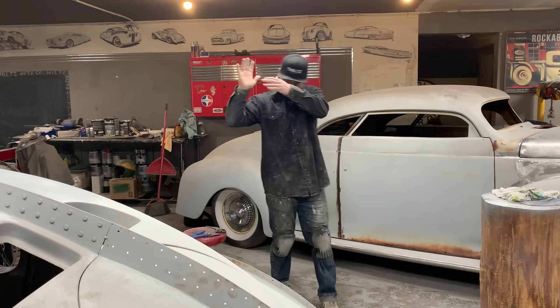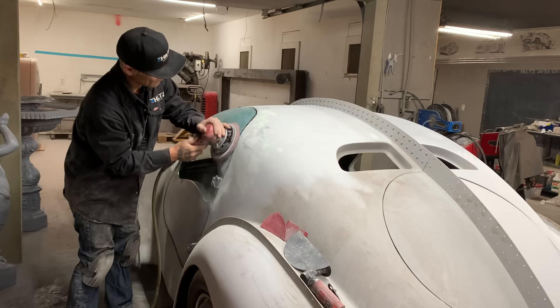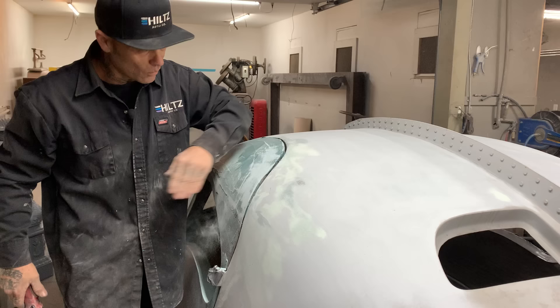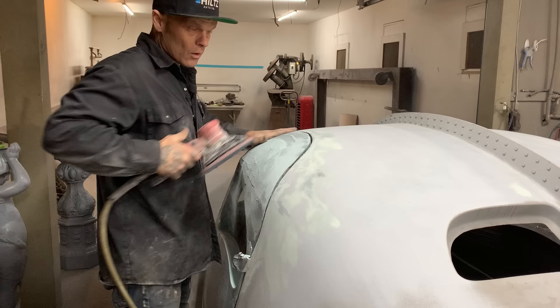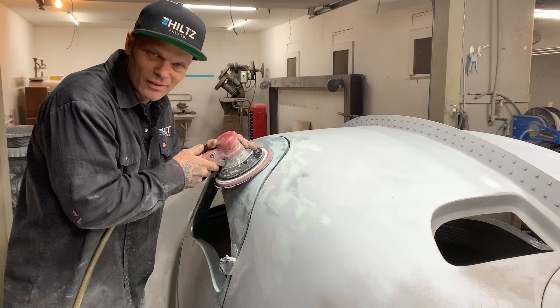That's how the doors will be made to fit right on the money - that's how I do it, and I'm going to show you as I do it. I'm just knocking this off the exact same way as I knock the body filler off - when I hit metal, I stop. It's the ocean floor, it's the end. When you see something that doesn't look good, they probably haven't got body filler in the right spot - that's probably the problem. No body filler. Everybody talks bad about fill, but I like fill.